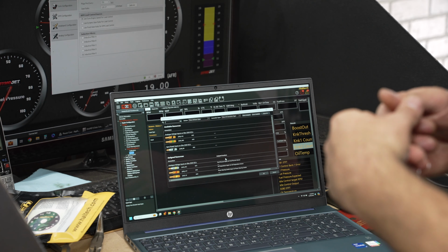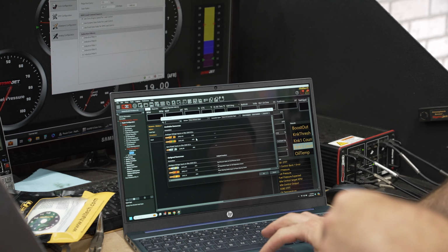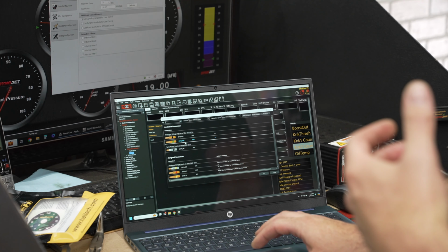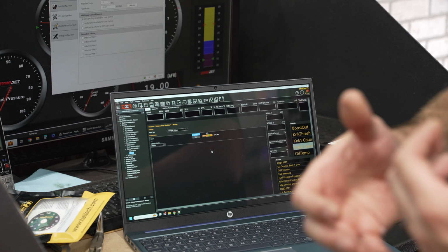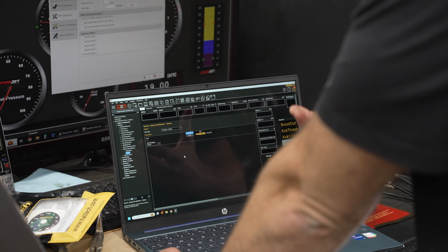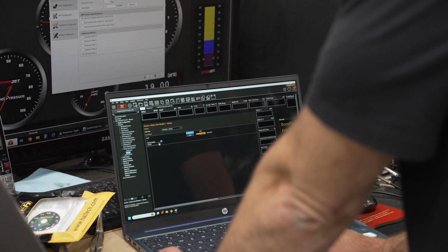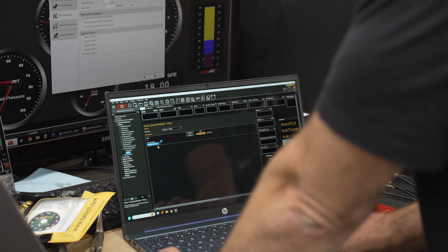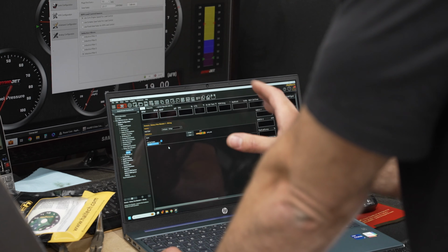That's used usually for the fuel temperature sensor. So we're not going to be doing any fuel temperature sensor. We can get rid of that basically since it's not being used, and we'll reassign it to use this. So we're going to use AVI 5, which was the fuel temp sensor. We'll assign it. We'll make sure that we don't have our pull-up. Pull-up is really designed when you're using a temperature sensor to have a resistor in line. So we're not going to do that.